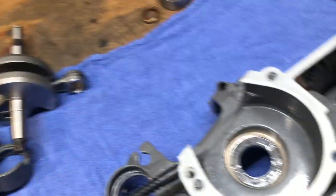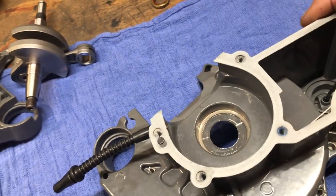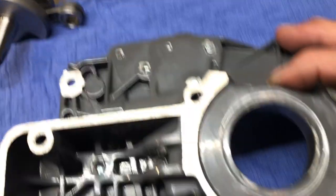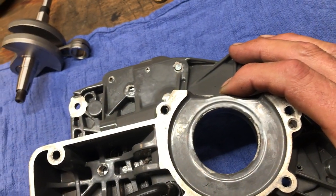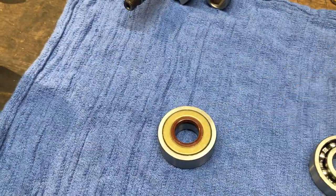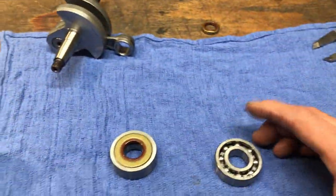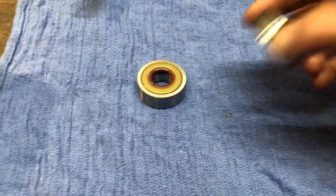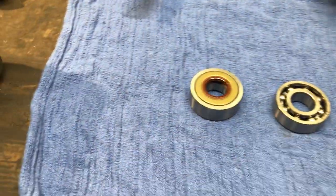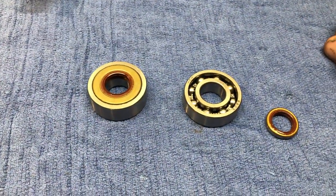The good news is that when they machined out the bosses for the bearing, it's a nice interference fit — I mean perfect. Pressing these out, you couldn't tell any difference; it's a nice snug secure fit. The bearings that were supplied are obviously Chinese bearings. There's no marking on the proprietary-type clutch-side bearing, and this one just says HC8S on it. Both bearings are nice and smooth — nothing wrong with them at all.